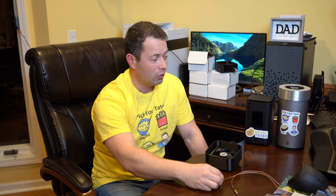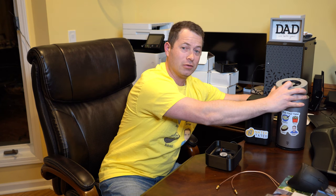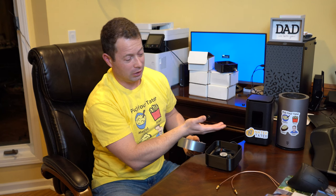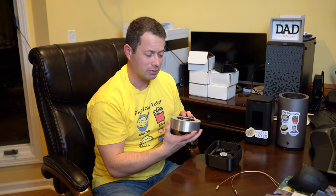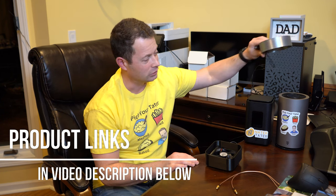I've covered the cooling fan as well as installing external antennas on both of these, but on this Nokia one, this is one of the cooling fans I've used. In the past, I also had one that was just a computer cooling fan that I put underneath the gateway. But then these guys on Etsy came out with this 3D printed cooling fan that made it very easy and quick to just put on top of the Nokia one — press it down, and it's secure, and then you plug it into the back of the unit. I certainly plug it into the back of the unit to keep this guy cool, because people have seen lots of problems with these guys overheating.